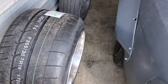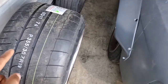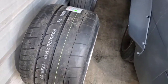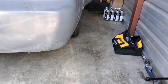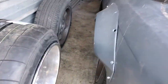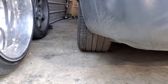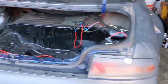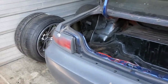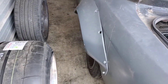It's killing me but I have to put these on the car — at least one side — so I can see how it actually sits, because I still have to adjust camber. That's the amount of camber I want on this side, and I have to make the other side match. You can clearly see it's a difference. I want less camber on that side. I'm going to get a leveler, take a measurement on the good side, and just match it up.